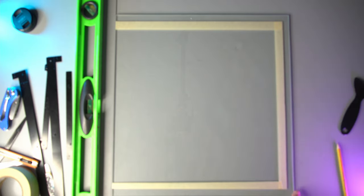Another thing to keep in mind: if you are removing this bar — this support beam — the case is already pretty bendy straight from the factory. So if the case is on an uneven surface, a gap will form because the whole case is kind of twisting. That used to happen even with the bar in there, but not as bad. Without the support beam it does happen very slightly — it's not huge or really badly noticeable, but it is there. Also keep in mind: if you're removing this, your warranty does automatically get canceled.